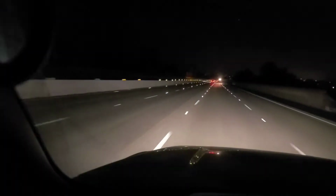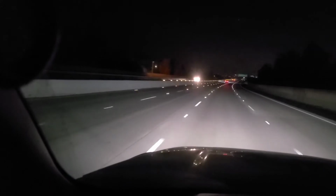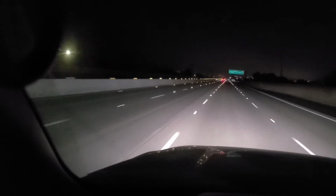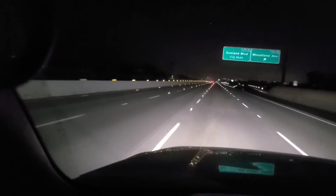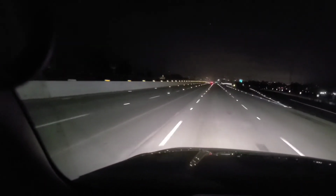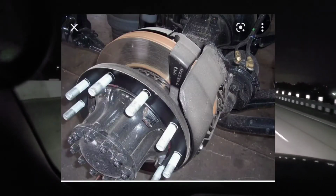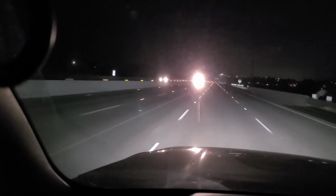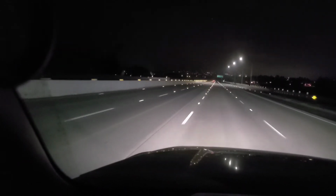They're really susceptible to overheating, simply because as you get the drum hot, the drum expands, and then the friction you can make between your brake shoes and the brake drum lessens because the brake drum just got further away from the shoe. A better system for that would be disc brakes. Most modern day cars now have disc brakes all around, and when compared to braking systems from, let's say, the 1960s, modern day cars will outbrake a Corvette from that era. I guess that's kind of the best way to put it.